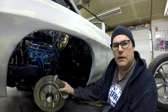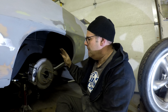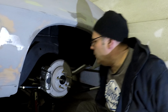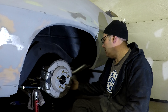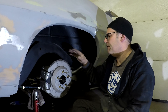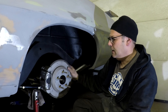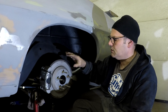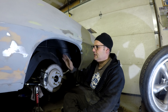I'll show you the rear while we're at it — pull the wheel off so you guys can see what I did back here. These are 2000 Camaro rear disc brakes, or anywhere from about 97-98 and up Camaro rear disc brakes. All you really need for this swap is the rotor, the caliper, the bracket, and a back bracket — it pretty much bolts right on. The only thing I had to modify was the emergency brake, so I bought some universal emergency brake cables and ran those. I paid about 100 to 150 bucks from the junkyard and everything was in really good shape.